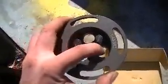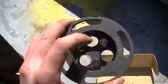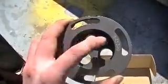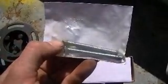These holes are for the bolts that are already there. There's going to be 6 holes on the side of that timing chain sprocket. There's 3 bolts which you will line up with these holes. These 3 thread into the 3 open holes in the timing chain sprocket that are provided for you. And also what I have are some M6, 6mm threads, and what I did is I took one right here at the end and I ground it off with a grinding wheel so that it would slide in through.